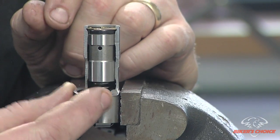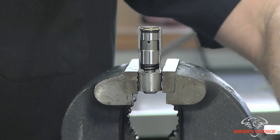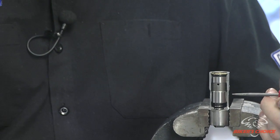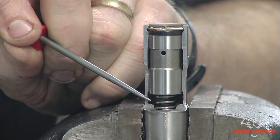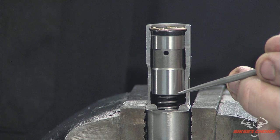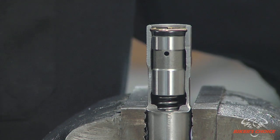What effectively happens when you put this in the lifter is that the 200 thousandths I was talking about becomes roughly 100 thousandths. When we adjust this lifter down to that washer we've raised the floor up and taken away some of the travel. There's still oil inside the LT kit — a reservoir of oil that can work its way through the one-way valve and pump up the lifter — but we bring the piston down so it's essentially just above that limited travel spacer, touch it, then back it off one full turn, or six flats. With the limited travel spacer installed you have the benefit of a solid lifter with the quiet performance of a hydraulic lifter.